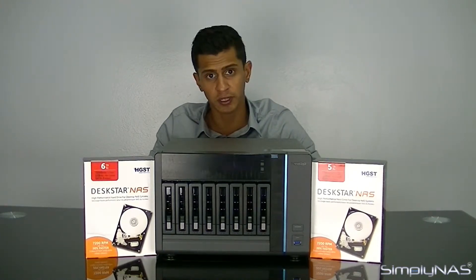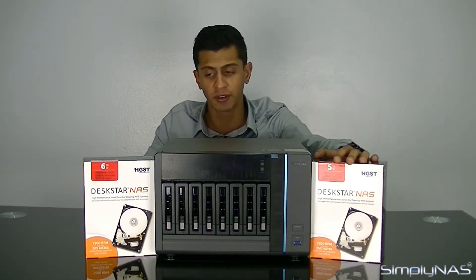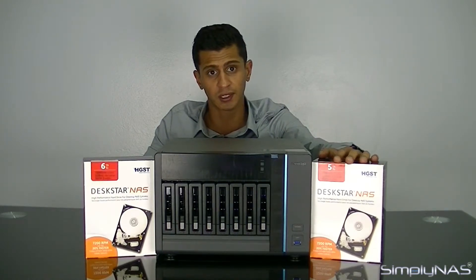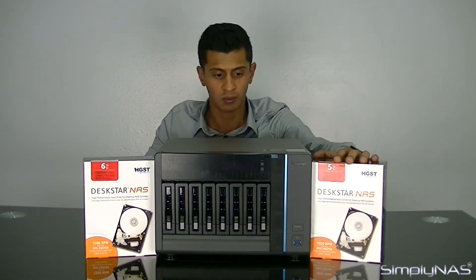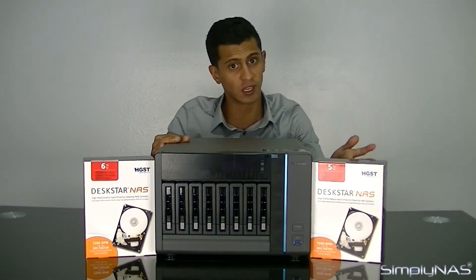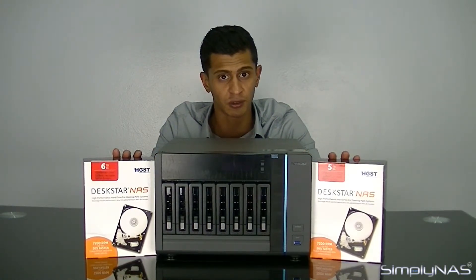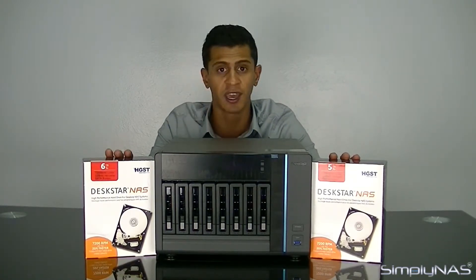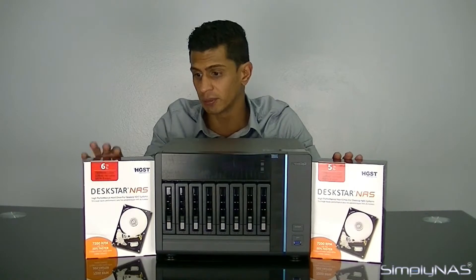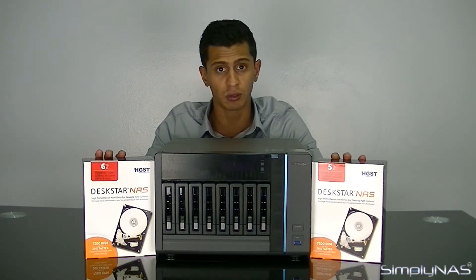This type of NAS can take enterprise drives or desktop NAS drives. We don't recommend going anything below a standard desktop NAS drive. The main reason is this NAS outputs quite a lot of power if you use the right hard drives — hard drives are very important to a NAS as they determine the IOPS you can get. Don't think that because this NAS can give 2,500 IOPS, putting a 5,400 RPM Western Digital Green drive in here will get you those IOPS — the drive cannot keep up. Desktop NAS drives are the lowest class you should use; they're still 7,200 RPM while being cost efficient and run a little bit cooler than enterprise drives.